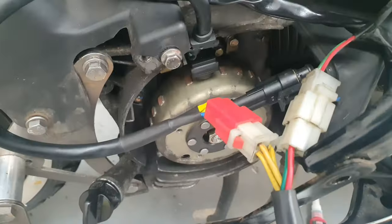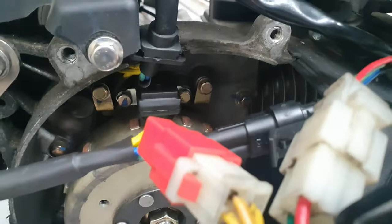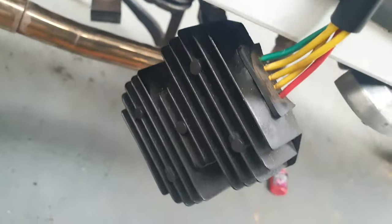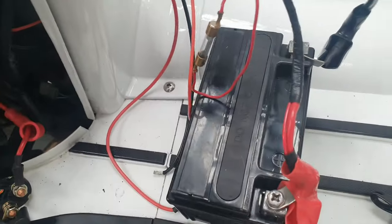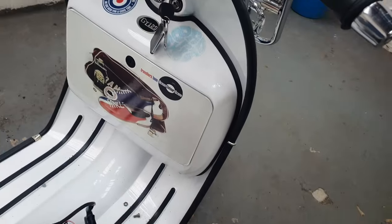The stator is installed — all put back together again, straightforward really. Cabling at the top neatly done with the bars holding it all in. Connector blocks back on. The rectifier needs bolting back on and everything cable-tied up. I've got the new battery here, but the problem is it doesn't actually fit into the battery compartment — the guy sold me the wrong physical size. So that needs to go back and be swapped, maybe for the MotoBatt that everybody raves about.